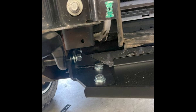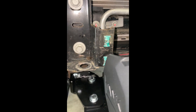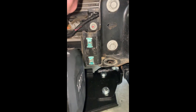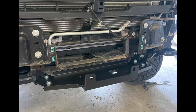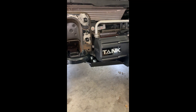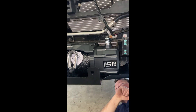It's looking quite neat, but we've used this bigger winch and now have the active shutter mount in the way, so we're just going to hack that off — just cut that driver's side; the passenger side is fine. Let's pull the winch back out again and rip that bracket off and cut off the end of it. As you can see, just removing that portion — once it's cut out of the way the winch fits in there perfectly.